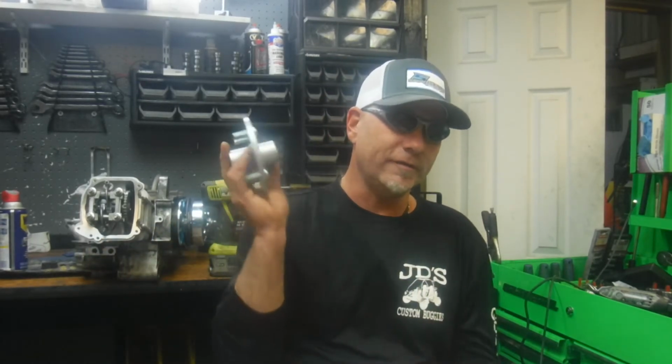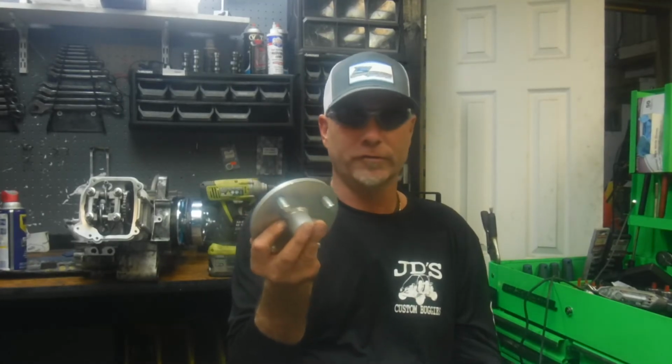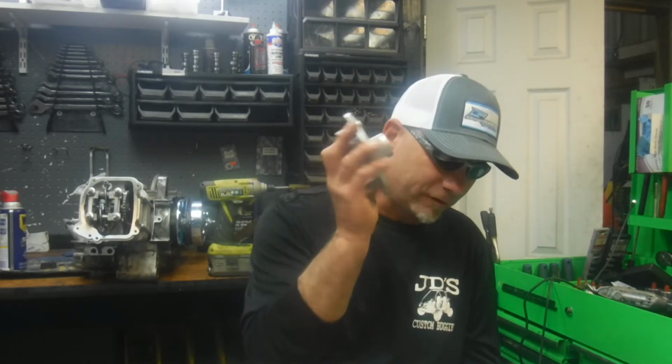Okay. The problem with these is 4 on 100 is not a popular size unless you have a golf cart. And even then the wheels are kind of fat. If you're looking for a good thin 10x5 or 8x5 ATV wheel, you're not going to find it in this lug pattern. So the wheels are very limited. That being said, I'm just not a big fan of these.